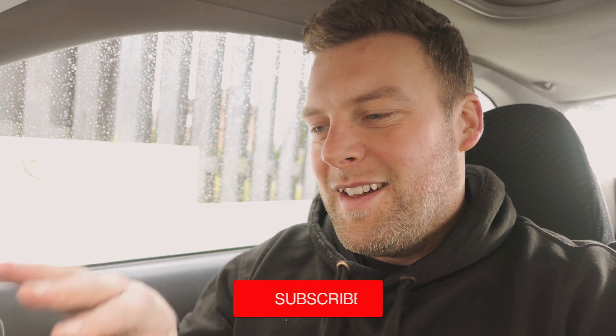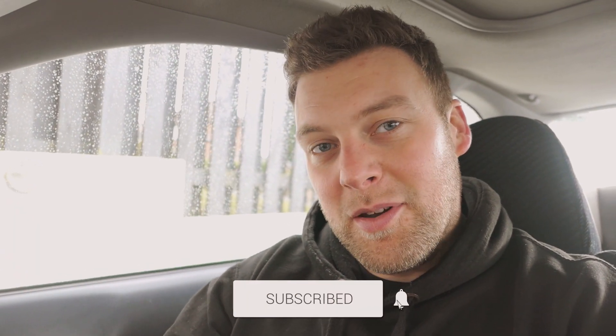Welcome back to another video. Today on the coupe I'm going to be doing the rear caliper on the left, and maybe doing something else as well. The weather's not happy - it's raining on and off. The caliper has lasted me just over a year since I freed it off. I wound the piston back and tried to free it up, it definitely worked, but it did need a rebuild. The slides and carrier will be fine - it's the piston within the caliper, so that's why we're replacing it today.